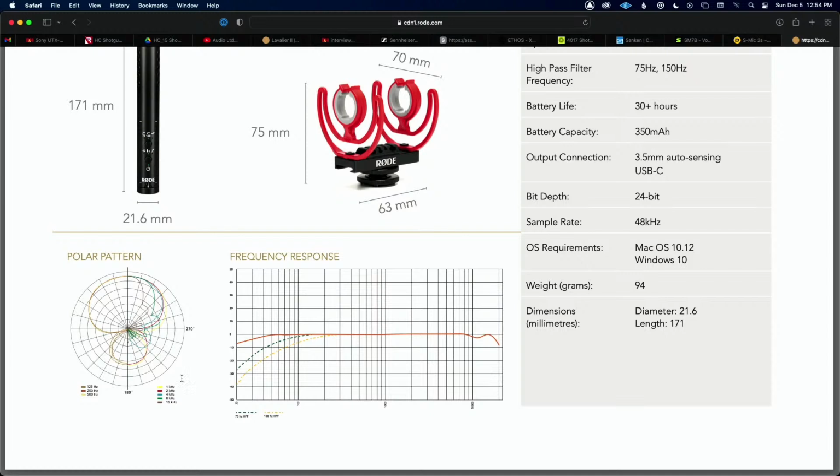That's usually really helpful. They're saying this is very flat through the sibilance range, and then there's actually a little dip, and then it pops back up after 10 kilohertz and then falls off after that. In theory, this is highly averaged, I will tell you that. You will see that a lot on the frequency response charts. They'll be very, very averaged. So there are probably little bumps and valleys in here along the way, but they averaged a lot of them out. So these are a little bit tricky from that standpoint.